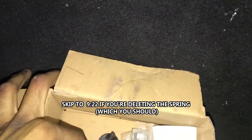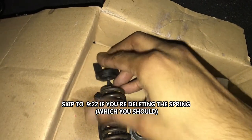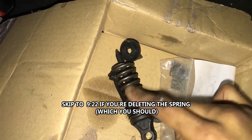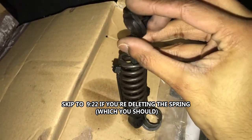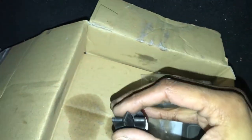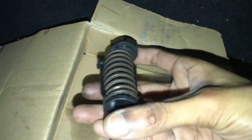I'm going to put the clip back on. Now I'm going to assemble the whole helper spring. The locking pin, the spring, and the top hat all go together. This goes inside here. I've already put the metal collar — the metal pin — on top, as I showed earlier in the video.